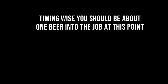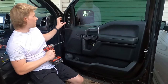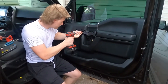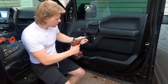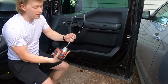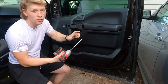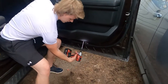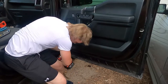We have seven 7mm bolts total. One is up here behind the first panel - easy. Two are on the door handle - easy. Two more are down behind that hard panel. Then two on the bottom which are tricky because they're at a pretty good angle - not straight in. Take a good look at the head of the bolt and follow that same angle, holding the socket like this rather than going straight down.